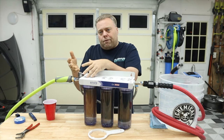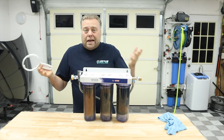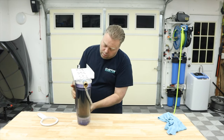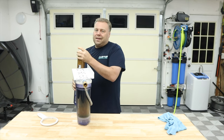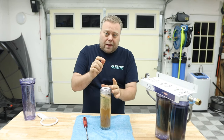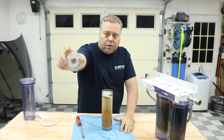With the first filter completely exhausted, let me show you how to pop the filter top off, since some comments said it wasn't refillable or that refills were hard to find. You should actually refill it yourself — you can use any two-and-a-half by ten universal cartridge resin. You get way over to the side for leverage. The biggest difference from other filters on the market is this one doesn't screw off the top — instead, you take a screwdriver, give it a little pop, and the top comes off via tabs.